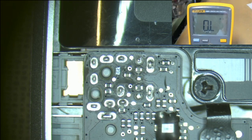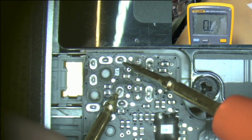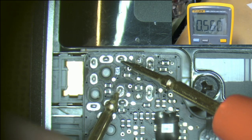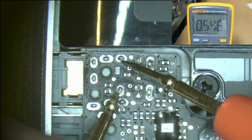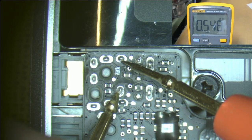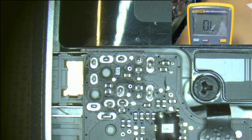So we'll have a look at pins one and two and check their resistance. Because there's nothing plugged in, they should be short circuit. We'll have a look at the multimeter and we can see that's reading really high — it's on the megaohm setting, reading 550 kilohms, which is very high. It's basically open circuit. If we short the leads together, this is what we should get — we should get zero. So because those pins aren't shorted together, we can deduce that this audio jack is absolutely stuffed.